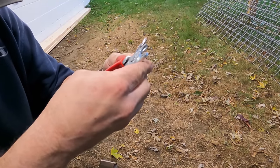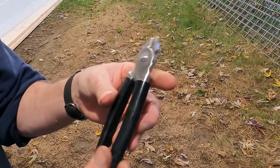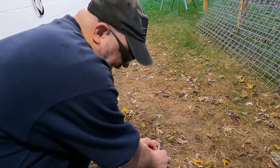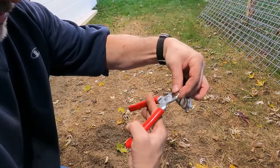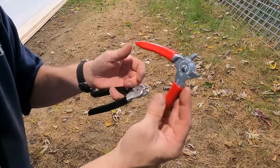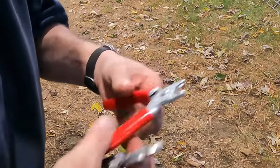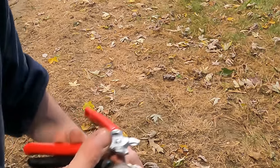There are two different kinds of hog ring pliers. One of them is actually made in the USA. I try to buy American when I can, but the other ones aren't. These ones spring open and these ones spring closed — there is a reason for that. When you're holding something in place, you want these to be ready to go so you're not fumbling around trying to get the ring in. The American-made ones actually hold the ring in place. These may end up being the ones I use all the time, but the other ones work the same exact way — when you put the ring in, there is a lot more spring tension against it. Both of these were around the $15 range; I'll include links below.